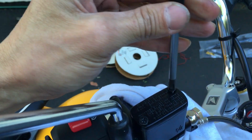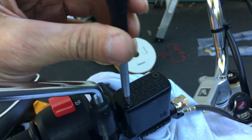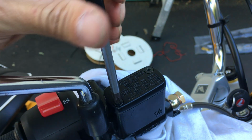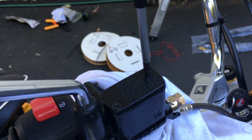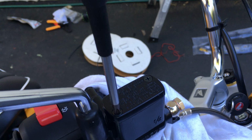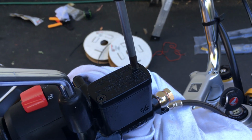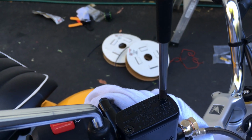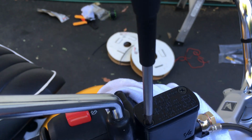And when you guys do this, make sure you use a Japanese screwdriver, a JIS, Japanese Industrial Standard screwdriver, and not a Phillips. A Phillips will booger up your JIS screw heads. There is a difference. They look the same to the eye, but there is a difference between the two. You can watch my Japanese unobtainium screwdriver video, where I talk about what the difference is.